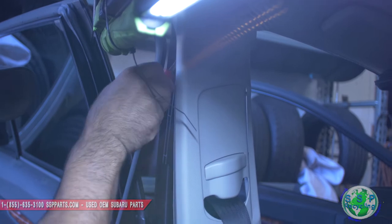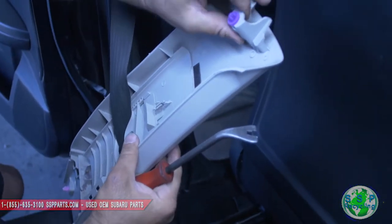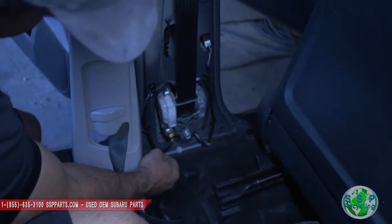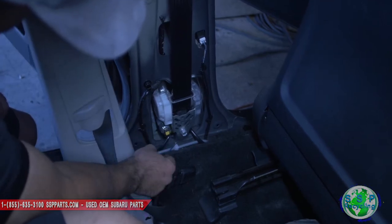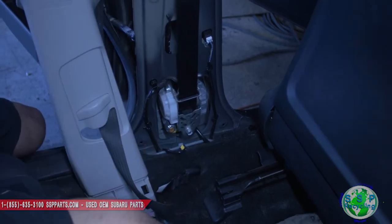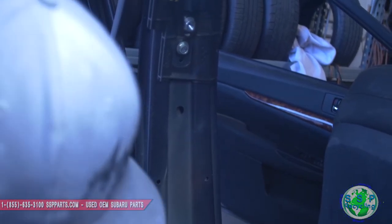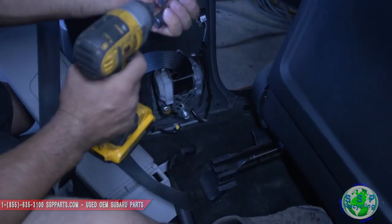Actually don't break that. Take the clip with one of these picks and take out the actual connector — you pick at it from the side and it will come out. Pull that out of the way, take a 14 — it's a 14 that comes out. Put a 14 down here and then switch it out to a 10.